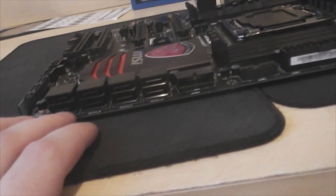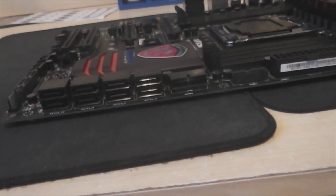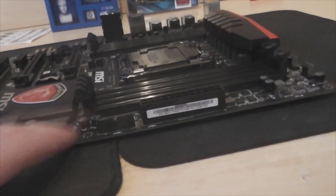That's one of the other things you want to look for — make sure the case you buy has got enough ports for all of them. Same with USB 3.0: if you're going to have two different things using USB 3.0, like two front-panel attachments — one attached to the case and then if you put a little screen in the front like on my old PC — that's going to need another one. So if you are looking to do that, make sure you have more than one USB 3.0 port.